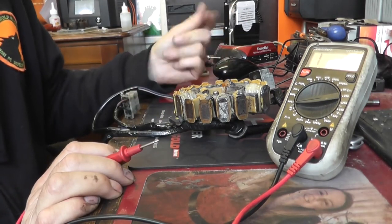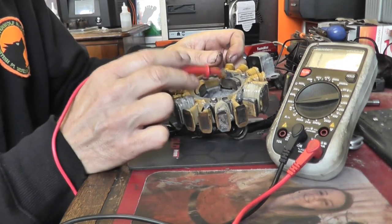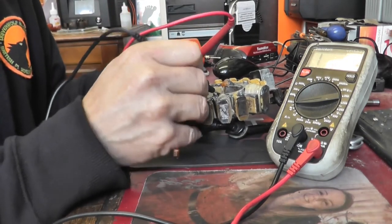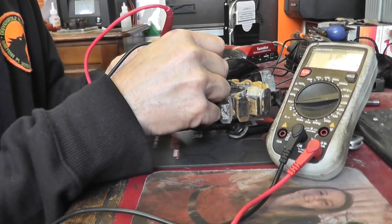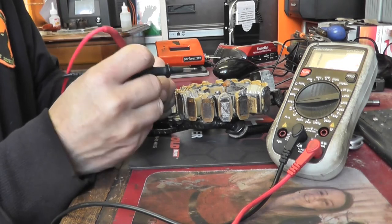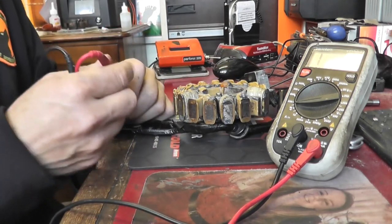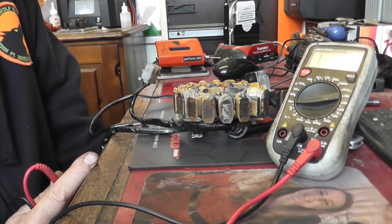So that's all done — just let the resin on the outside dry off in the sunshine. They've got a little bit of skag on the inner pickup coil but I've seen them worse and they still run fine. Just double-checked the reading on that one — pink to ground is giving 17 ohms, which is about right. And the pickup coil is showing 44 ohms — so that one's good. They either work or they don't — either give a reading or nothing at all. So yeah, that's ready to go back to the customer.